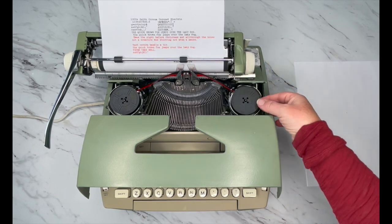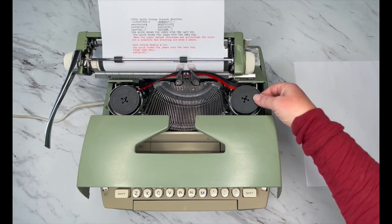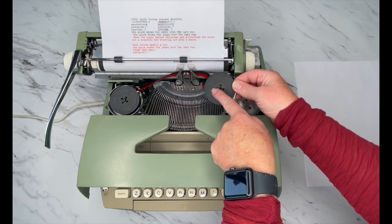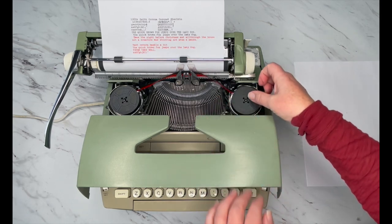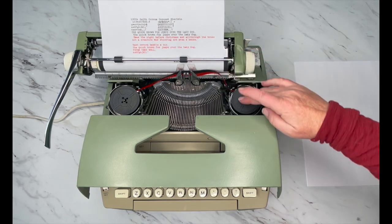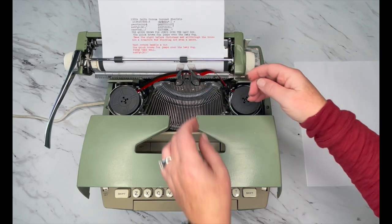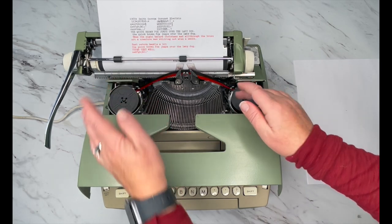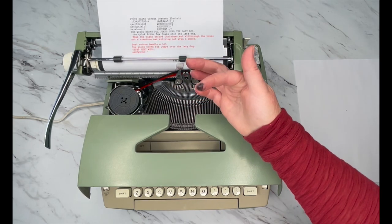When it's time to change out your ribbon, you just lift out your spool and then pop the new one in. When you put the new one in, there's a little pin next to it — there's a big one and then there's a little one. That little one needs to go in one of these four holes on here. You may have to kind of jiggle it around a bit until it pops down. It is a little messy job, so just be aware. And then you need to make sure that that ribbon is threaded through all the guide wires properly. To get it through, you have to go up top and kind of pull on it a little bit. I'm not going to take it out because one, it's messy, and two, it's a pain.